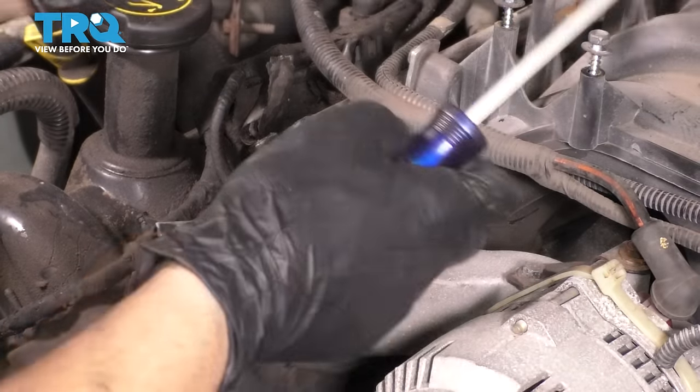I had several studs that were stuck in here and one of them was broken. Had to weld a nut to that one and get it off like that. And then I had a couple that I used a double nut method on, it didn't work. So I had to weld a nut to it and pull it out. And some of them did. The double nut method worked.